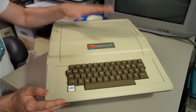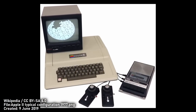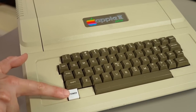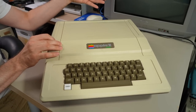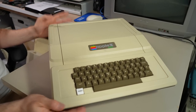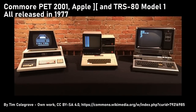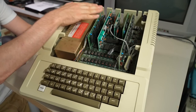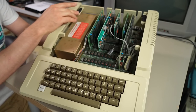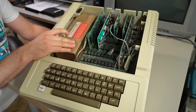What you see here on the bench is one of my Apple II Pluses. This computer was the basis for that clone machine. The 2 Plus itself is the successor or slight evolution of the original Apple II. There's really not a lot of difference between the 2 and the 2 Plus other than the badge and the power light on the keyboard. Really, all Apple did is upgrade the ROMs — that's it. An original Apple II can be upgraded to a 2 Plus simply by switching out the ROMs for the 2 Plus ROMs.